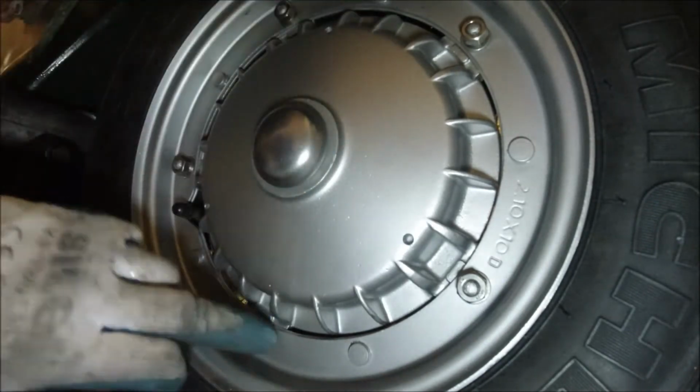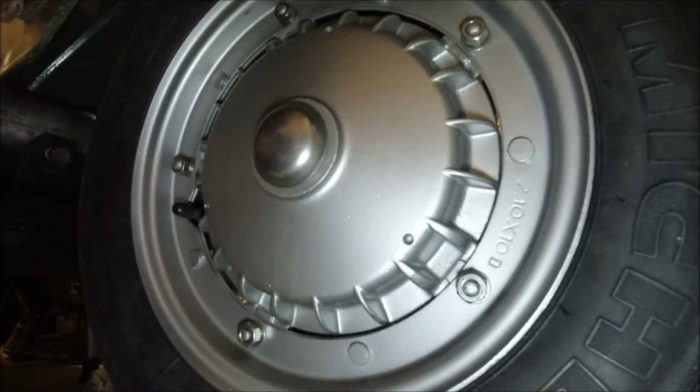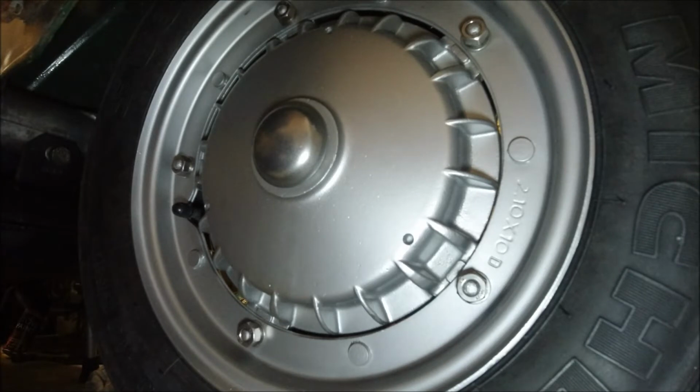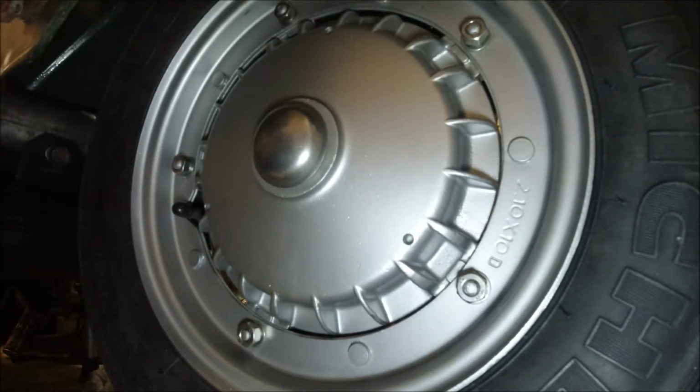That's rear wheel done. These are already torqued, 14 pound, or like I always say, tighten up and then give them an 1/8 of a turn more. Mechanically wise, the engine now is done. I'm just waiting on the battery to recharge to stick it in, put the spare wheel on, put the panel on, fire it up and show you the lights and the horn and what have you, and run it up on the yard for a while.